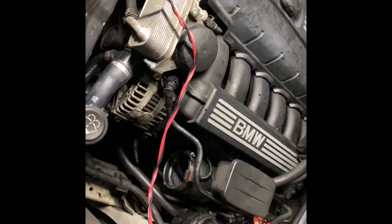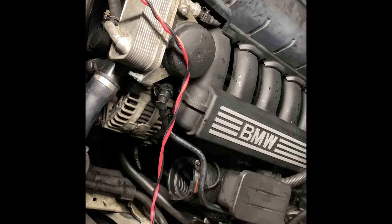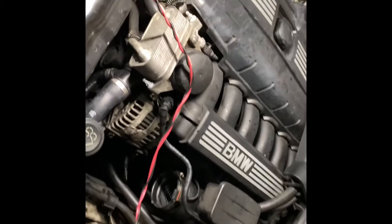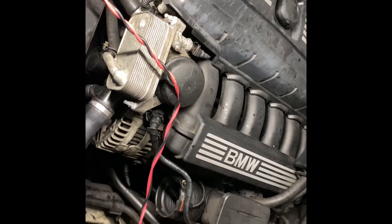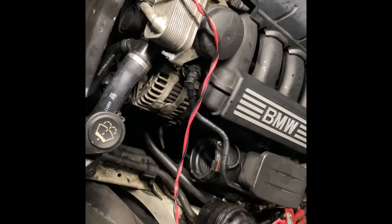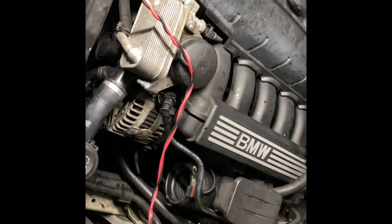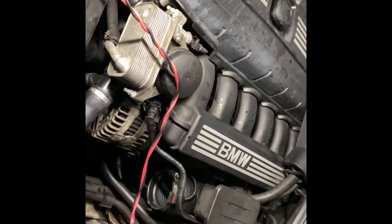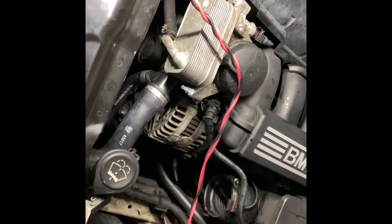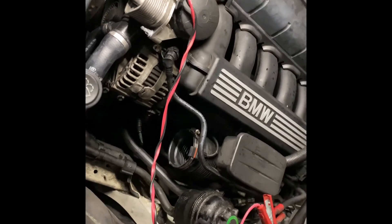Take your time with it. The important thing: if you ever get a coolant leak, do not try to push it. I was close enough to my house and from a cold start it takes a bit for the engine to warm up, so I had some leeway. But do not risk it if you get an engine overheating warning — on a newer car that could void your warranty. These cars do have a tendency, if they start overheating, to blow the head gasket, as with any car, but BMWs are a bit more finicky. Don't try to be superman.